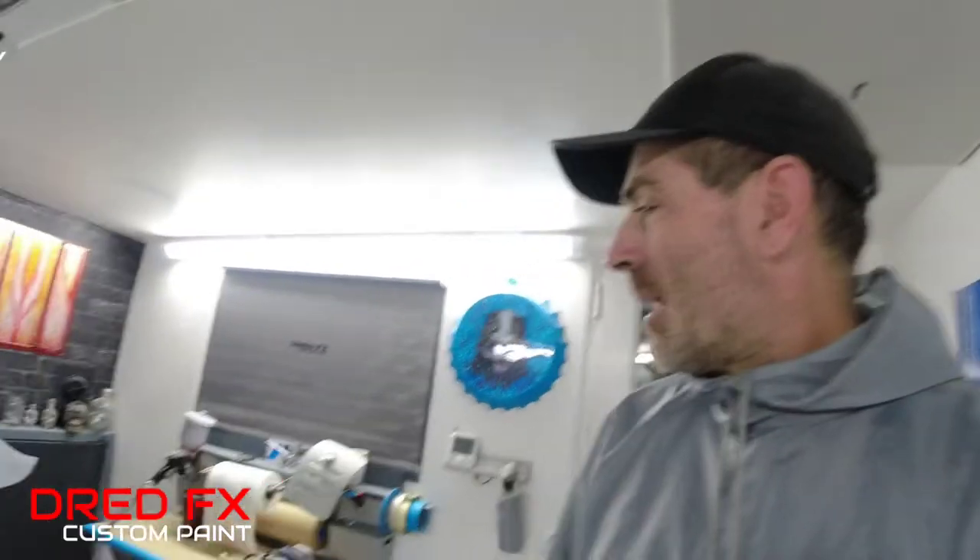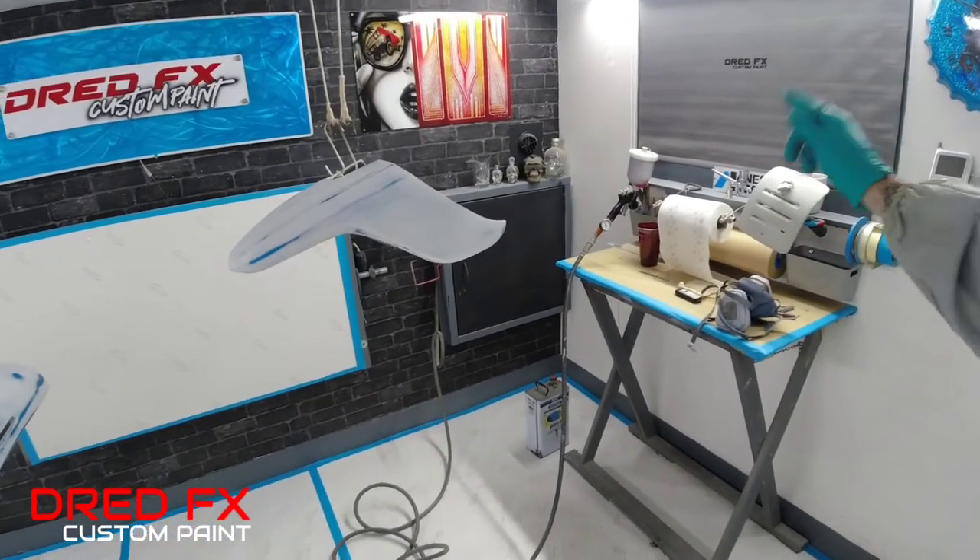I've put the plastic primer down off camera — just dusted in around the edges, any breakthroughs, a little bit of plastic primer. I've got the crimson mixed up, got the gun set up. I've cleaned these down, tack ragged them, blew them off, so they're good to go for base coat. Now I'm going to go in really light, just do a very light coat all the way around and just build these coats up to full coverage, nice and light.